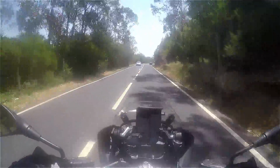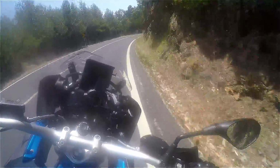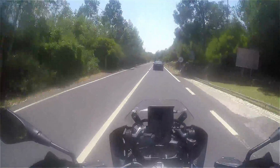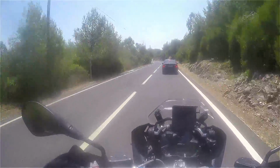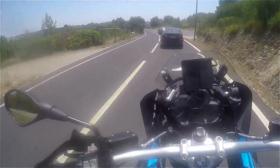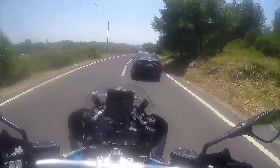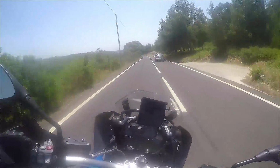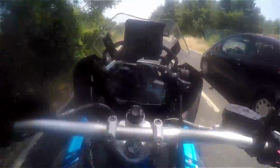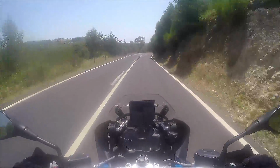You don't need a clutch to shift at all. Okay, at pedestrian speeds you will be using the clutch because, well, it's a habit. And if you don't accelerate, the upshift doesn't actually work. But when you start riding a bit faster, clutchless. Like now, see? No hands. Down. I think you can actually see my left hand on the camera, so you can see that I'm not moving it. Gonna have to be one by one. It's just such an easy bike.